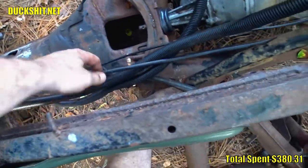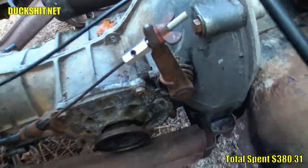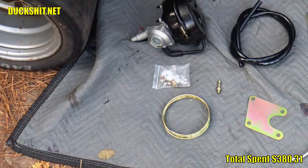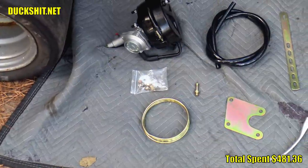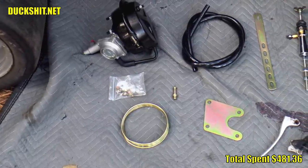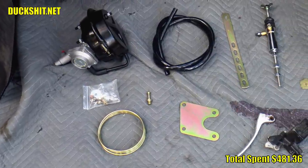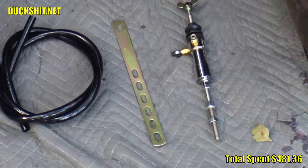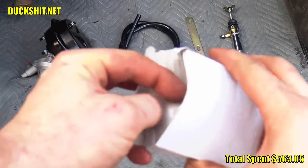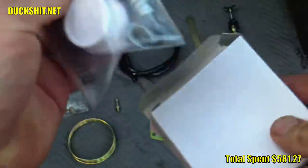This all comes prematurely, however, as I haven't finished gathering all the necessary expensive parts to make this work. A few people in the comments are in alignment with the parts I have been collecting, and they kind of knew without even actually knowing — good job, you guys. What you're looking at here is a brake booster servo — an inline model that should work inline with a hydraulic clutch. It came in kit form and looks pretty thorough, with mounting brackets, hoses, lines, flare nuts, and all the nuts and bolts to get it set up. Units like this are rather popular for vintage cars that don't otherwise have provisions for boosted brakes. Also among these parts you can see a hydraulic clutch slave cylinder for a VW transmission and a hydraulic clutch master cylinder for a hand lever. I also picked up a rebuild kit for this master cylinder — I seem to remember this unit in the past was not pumping correctly, so I hope this all works.